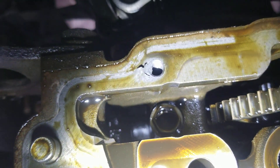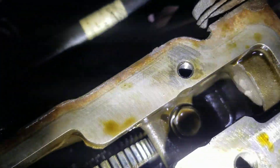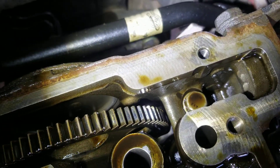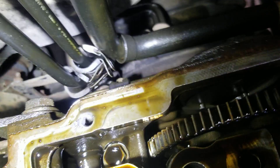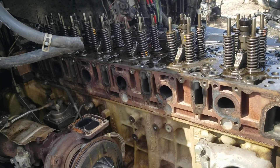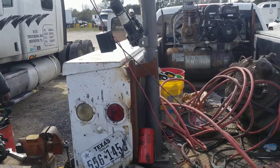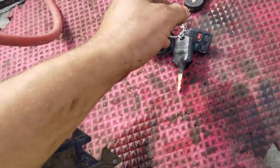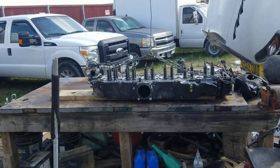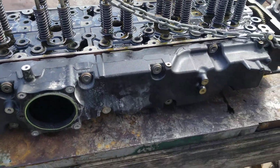This is the back of the cylinder head. There are bolts by the gear — make sure you remove those before you try to yank on the cylinder head, otherwise you're going to break that head. Now the head is ready to be removed; we just have to figure out how to hoist it and lift it off the block so we can look at the extent of the damage on this particular engine. Let's see what's going on with this head now.